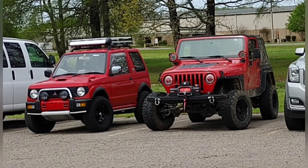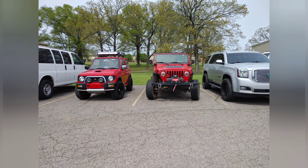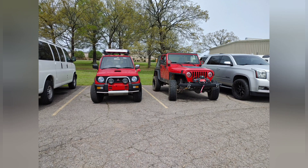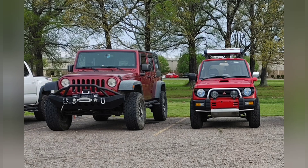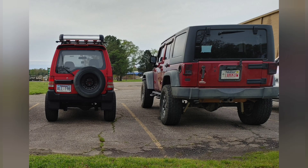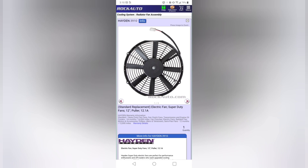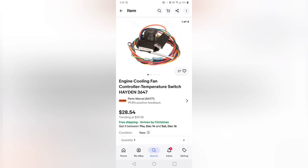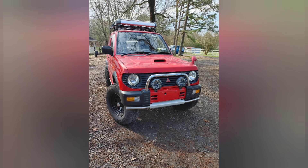Since that last clip, I've put about 1,000 miles on the Pajero and actually got the other upper radiator mount put in, and it works great. I did have to upgrade the electric fan to a Hayden model that has a higher CFM, and also a Hayden fan controller. Like a lot of people in the Facebook group have mentioned, it does struggle to keep good temperature above 90 degrees Fahrenheit outside, above 55 miles an hour — there's just an airflow issue. But if you keep it below 55, around town, all day, air conditioning, 110 degree weather, it does great. I would look at this as more of a factory replacement that's easily sourced here in the States, versus an upgrade — it's not necessarily an upgrade, but it does work fairly well.